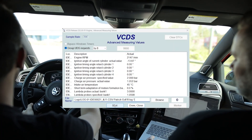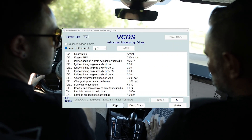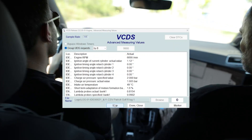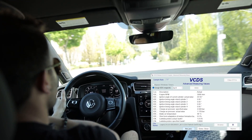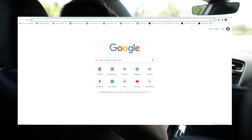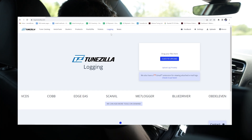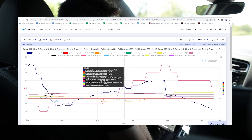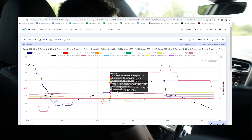I'm in third gear, just slowing down to about 1800. J-Man, click start. Done. I just click done, and I can leave VCDS running. Let's go to tunezilla.com, go to login, click upload, then click upload again. Select 'patrick.golf.log1' and click that to upload it to the website. And now it's spat out a nice graph instead of just looking at an Excel spreadsheet of a CSV file.